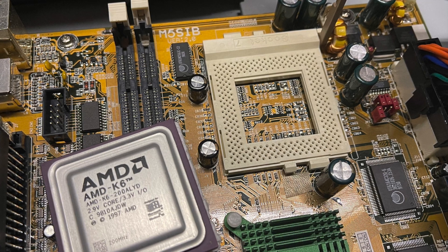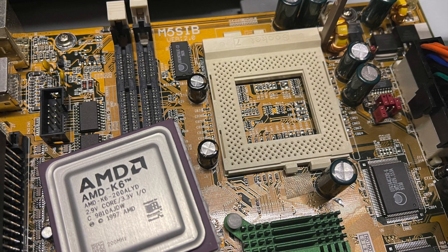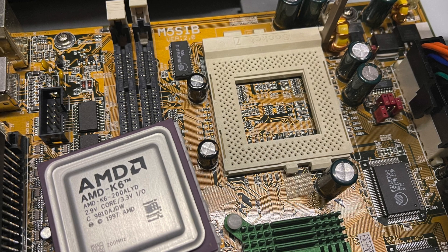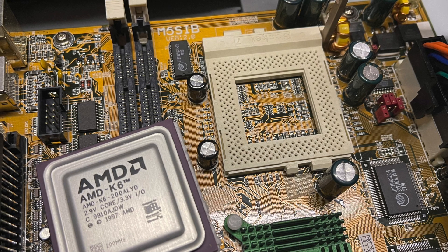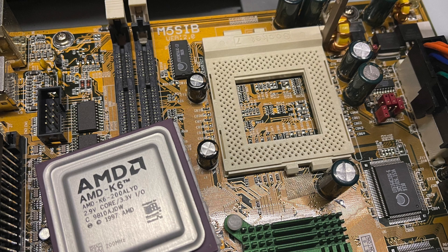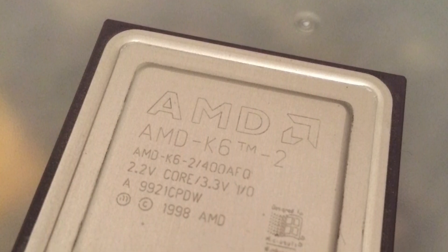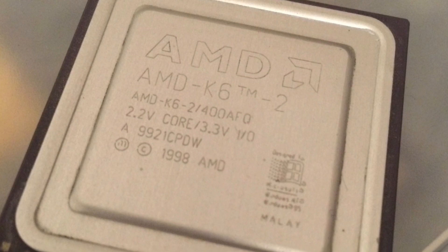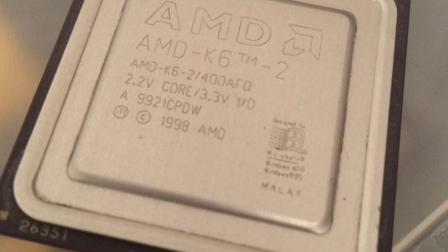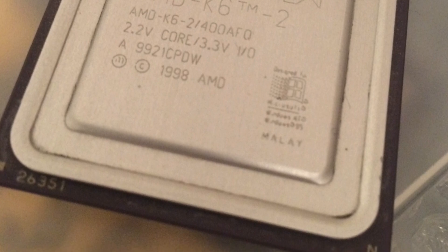That's the breakdown of the CPUs. The M2-333 and the K6-2 are definitely by far the best CPUs of the bunch. But personally, the K6-2 300 is definitely the best. I tried to run a K6-2 400 on this motherboard with a 66 MHz front-side bus but it didn't post, so I'm not sure if there's a limitation somewhere. But if you've got this SAS board, the K6-2 is definitely the best CPU, and following that, the Cyrix M2 is definitely not a bad chip to have for this machine.